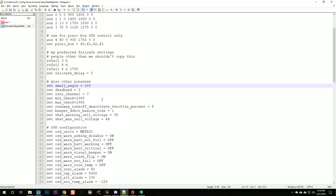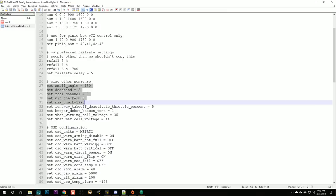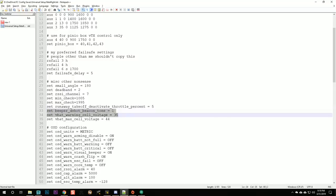Do we want to turn off small angle protection? Yeah, probably. Leave the anti-TAS protection on — that's probably a good idea for this great big quad, though if it bumps something we don't want it to drop out of the sky. I'll leave that for now. Should we be using a motor beeper with these gigantic motors and ESCs? Maybe I'll put a beeper on it.